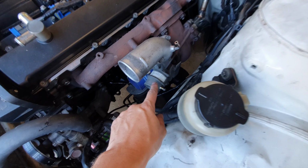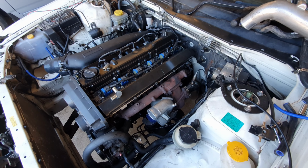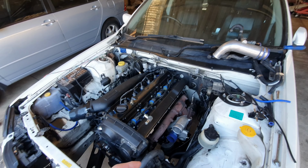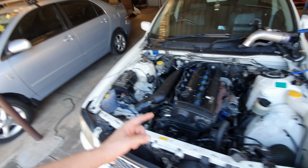So what I'm going to do is order one of these offline. It's about $100, bolt it on, and then it just plugs straight in as factory and no one ever really knows. There's nothing to give it away. What that means is you're going to have 14 PSI on full boost. So the way to then have this boost controlled is to basically just use your right foot, use your throttle foot to slow down on your boost, and you just drive it accordingly.